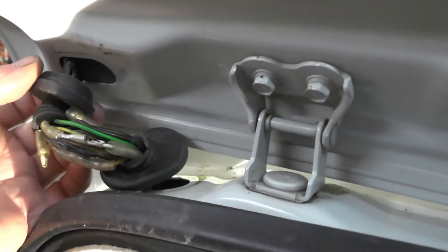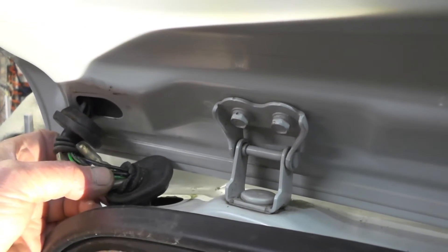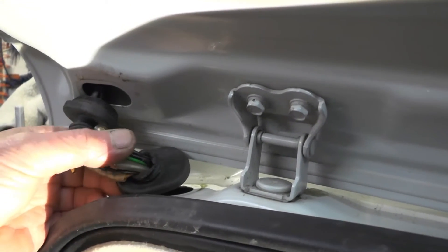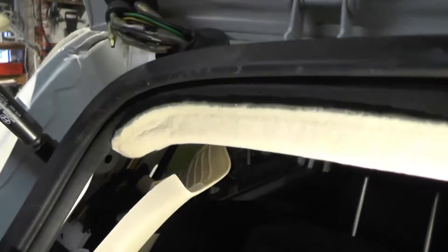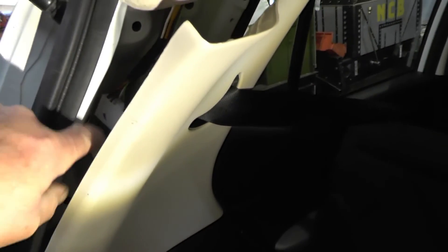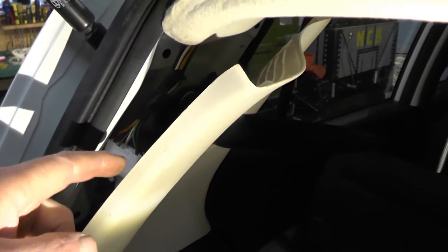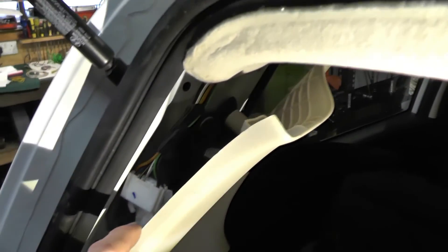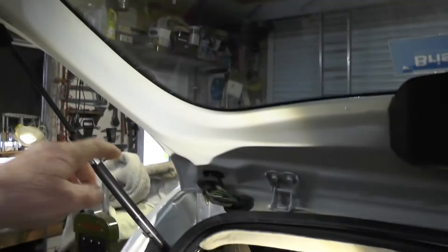What you've got to do is get this rubber boot out. If you've not already split it you might get away with unthreading it without splitting. You also need to take this rear panel out — or just release it — to get to the plug on the wiring loom. I've undone that plug so all the wiring up to the tailgate is now dead. If you're not going to undo that plug, take the negative off the battery so there's no power through the wires, because it might blow fuses or damage other things.